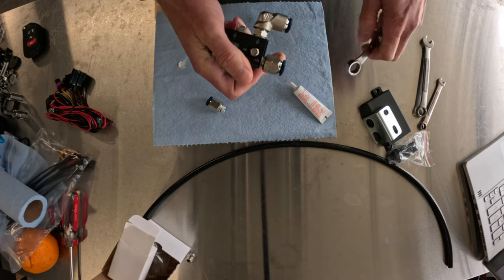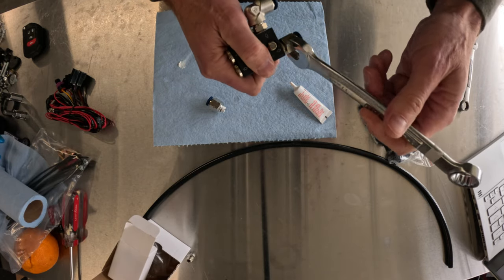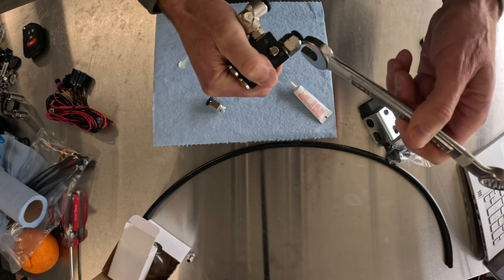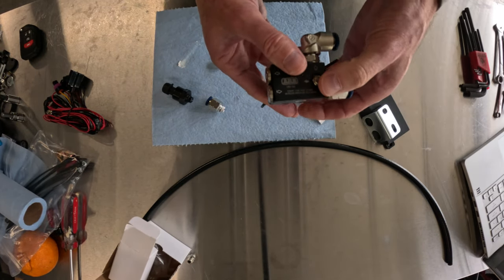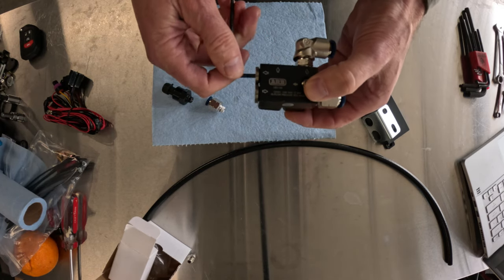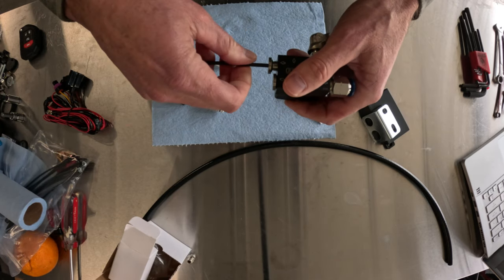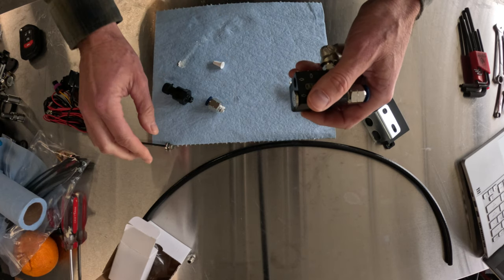This next one is a 17 millimeter — same thing, don't crush that o-ring, just snug it up good. You've got thread sealing in there and an o-ring so it doesn't need to be overdone. The other one we're going to remove is the top one on this side — also an output — that's a 3 millimeter allen head. Pull that out and that's actually going to the passenger side output.